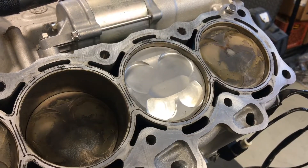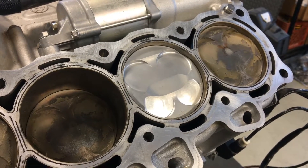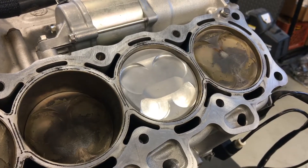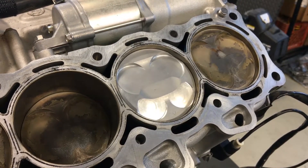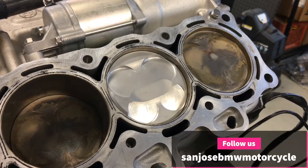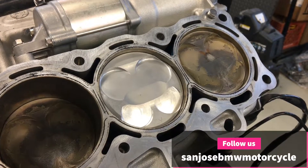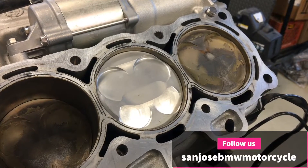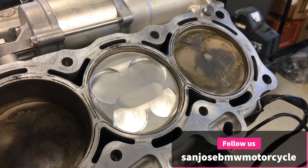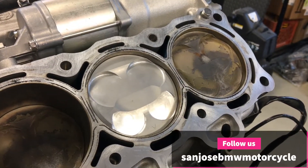Just a quick update here. Number 3 cylinder — all the crud and dirt and stuff, we got cleaned out of there real good, no problems at all. I just put a standard piston in the number 2 cylinder, that'd be the one on the left, and then the one on the far right is the standard HP piston. Went over them with a caliper and can't find a bit of difference in the dome shape between the two pistons. Visually they look very different because of the carbon on the one on the right, but if you look closely, the valve cutout's the same, dome is the same, everything's the same.